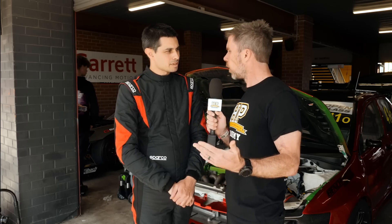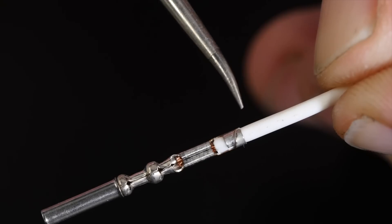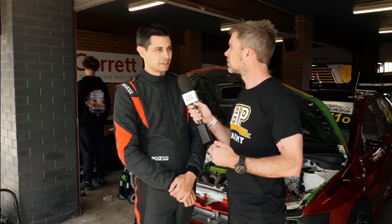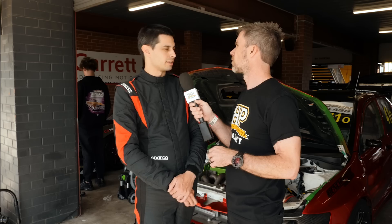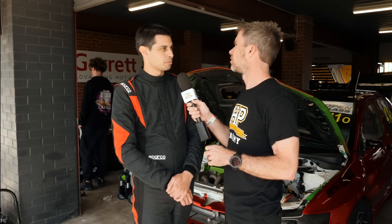In terms of the wiring, you did the wiring course but you actually haven't wired the car yourself — that was still helpful to you when working through the design process. How did you use that course? I actually started with the intent to do it myself, but I didn't have the experience in building it. I had the knowledge at that point and I really wanted a well-polished product for ultimate reliability. What I took from the course was being able to decide on sensors, what hardware I needed, what sort of inputs, and where the sensors would be wired to. I did all of that myself — the documentation, pin outs, diagrams — and then took that to a professional motorsport wiring shop. They made a few changes they'd recommend and then built the harness off that.